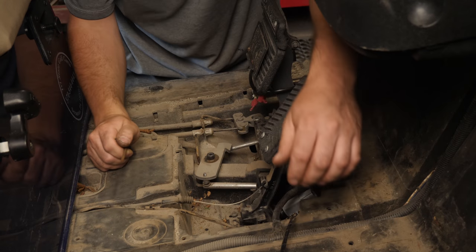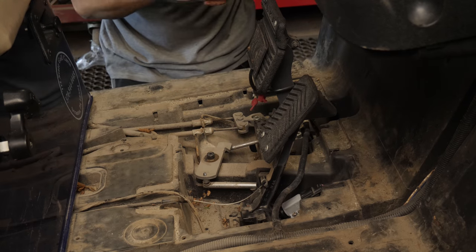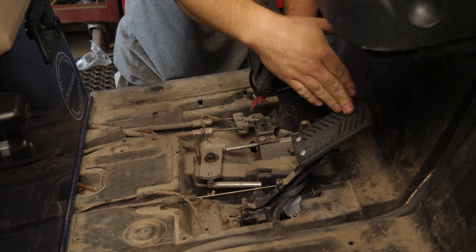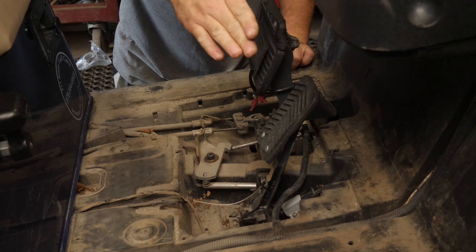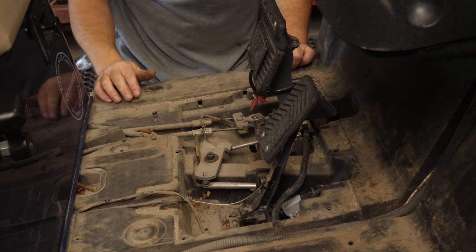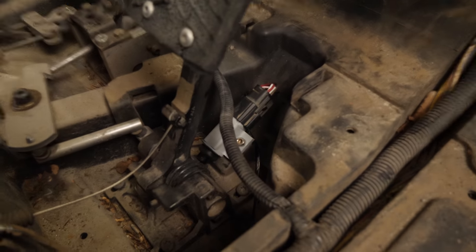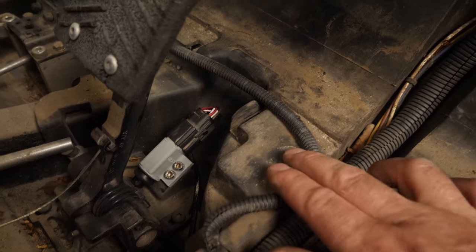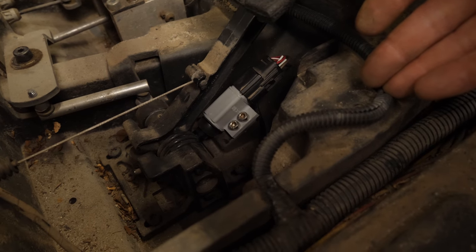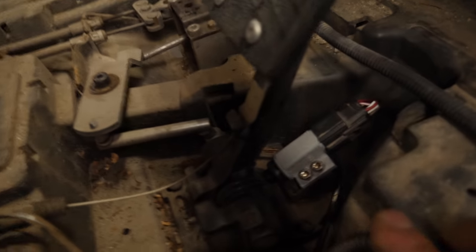Let's just get this in. Now we'll plug it in and then we'll keep it in neutral. Beautiful — perfecto. Let's put this all back together. Move this wire out of the way — it's for the brake light switch. You can see how the switch mounts in there. It's held in with those two Allen screws. When you step on the pedal it opens and then it closes, so it actually rests on that little lobe on the accelerator pedal. It's a nice design.